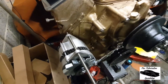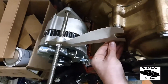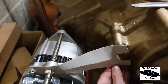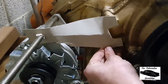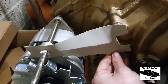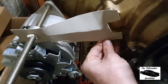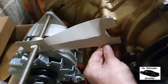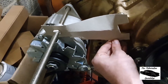There isn't really a lot down here. The position of where the cross member goes is going to be roughly along there, so we should have clearance. Of course if we don't, I'll have to do some modification later on, but we'll certainly clear where the header pipes are going. I've just roughly mocked up a cardboard template here with a rough fold in it, just to ensure I can get the angles vaguely right when I transfer this across to metal, and then we'll chop it out and bend and hammer it into shape.